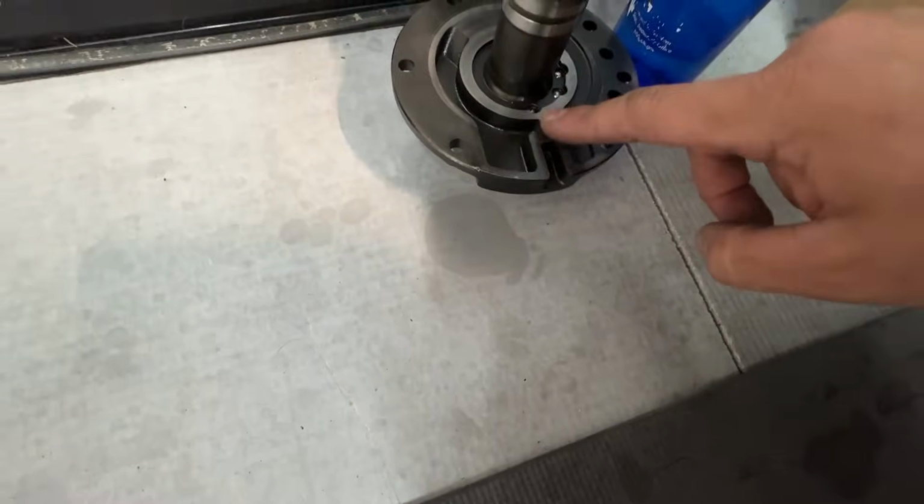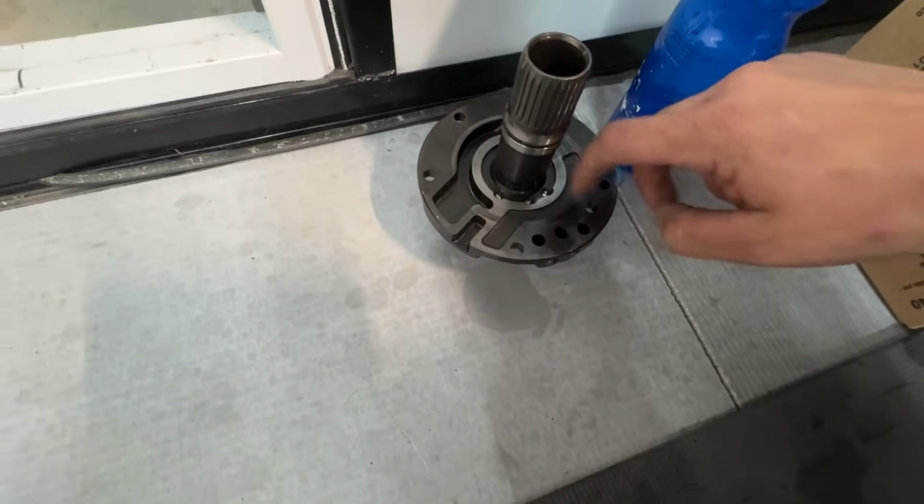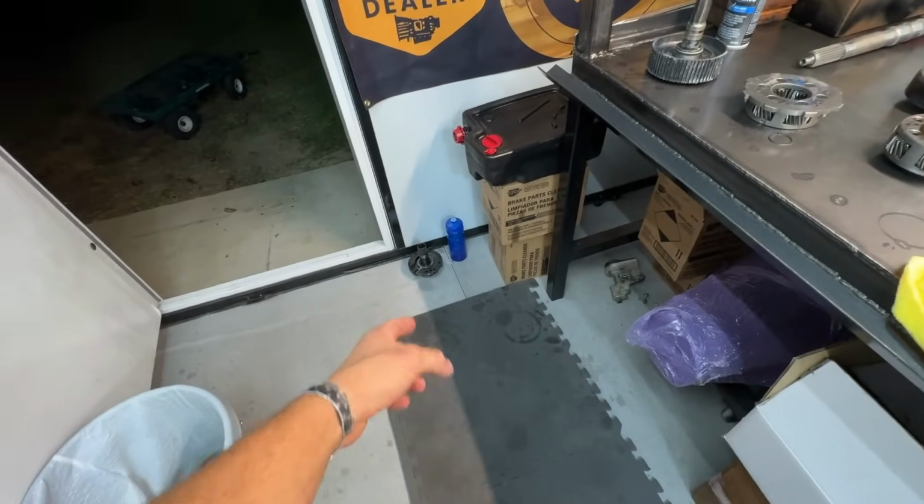He did gouge the pump pretty good, and you guys can kind of see here, I already threw his pump away, but there is some deep scoring on this stator tube, catch a fingernail, break a fingernail off scoring. And then you saw that broken sprag, his direct clutches were fried. I would imagine there's a ton torn up in the converter too, because it melted a couple of the seals on the converter. It's actually melted inside. And his input shaft had some definite signs of overheating.